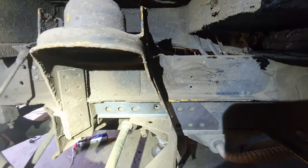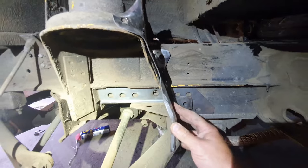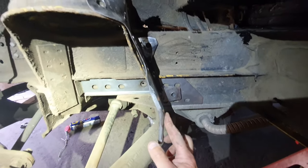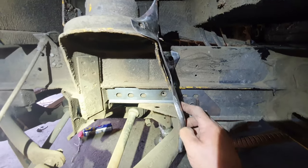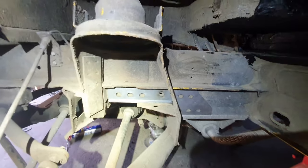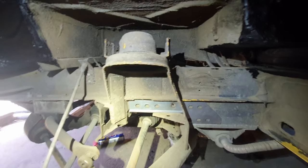I have to cut a slot out of here, which was on the original van. This fits more or less just like that — it fits to the rear end of that spring support or shroud and gives it a little bit of extra strength. That bit welds to that and up to there, with lots of big puddle welds inside these bits once it's all clamped up tight. It gives the whole shebang a little bit more strength.